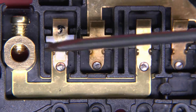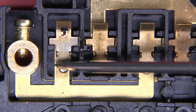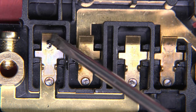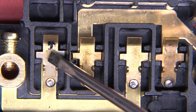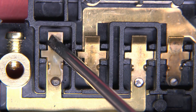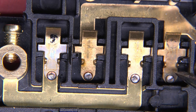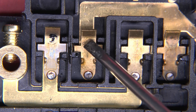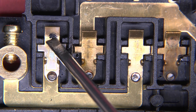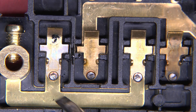Now here's a look at the terminals and switches in a bit more detail. This is one of the conductors coming in here — that's where the wires would go — and it just basically goes straight across. And this is the one that wasn't working: you see there's that black residue there where the actual thing on the switch itself has basically melted onto the piece of metal, although the metal itself does still move reasonably freely. And if you look at the end of these things here, the little contact points are all fairly well damaged and blackened on all four. The other contact does move correctly, but this one, presumably because of that melting, the actual plunger wasn't pressing down on it far enough, so it wasn't coming up to meet the other contact.